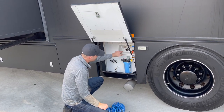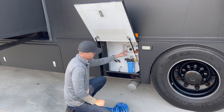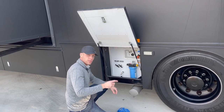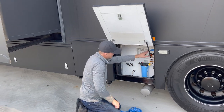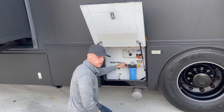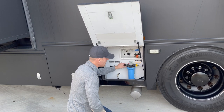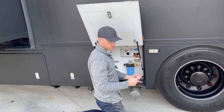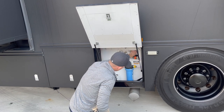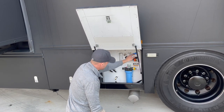When you put the hose on you've got hot and cold. This little black fitting is the black water sewage flush — when you dump the valves you connect a hose there, turn the faucet on, pull the black valve open, and it flushes the sewage tank. Down here there's a little blue valve — currently it's in tank fill mode. Hook a hose here, turn the hydrant on, and it fills your water tank. When it's full it'll run out the vent or start spitting out on the ground. If you're on city water, hook the hose in, press this down, twist the valve, and it switches to city water. If you're running on your fresh water tank, make sure that valve is in the up position.